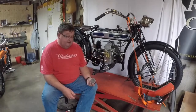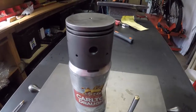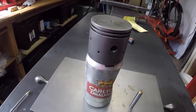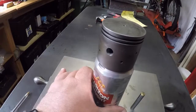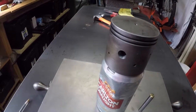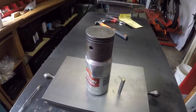I'll show you that and then we'll come back to the bike. Let's come in and have a closer look at the piston and the ream out. Here's the reamed out hole — it's done a lovely job. Really happy. Tiny chamfer on the edge. There's the other side, which allegedly is a thou smaller with a thou taper in it. It all sits together really well, gudgeon pin just sitting down there. Really happy with it, and 20 dollars is neither here nor there.